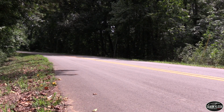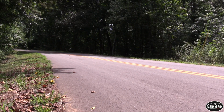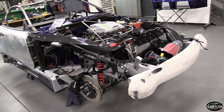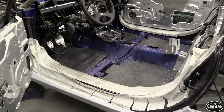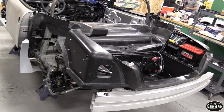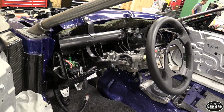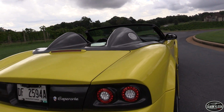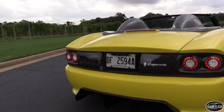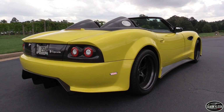Underneath the bodywork is a patented modular extruded aluminum chassis with tubular steel subframes and carbon fiber composite superstructures, some of which can be seen across the entry thresholds. The Spyder and Spyder GT are both open-top vehicles by default, unlike the Esperante convertible, which has a foldable soft top. In order to maintain a high level of stiffness and torsional rigidity, engineers upgraded the A-pillars with a high-strength tubular steel structure compared to the traditional stamped parts.